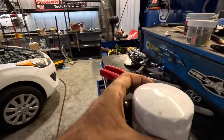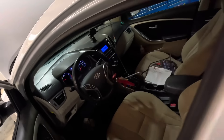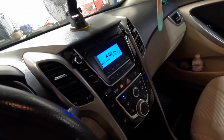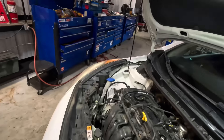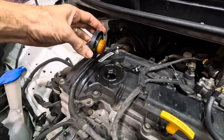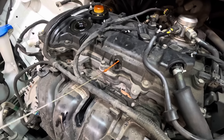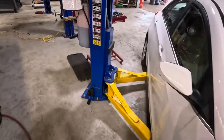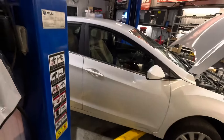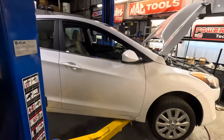It's been past the allotted time — let's check the clock. I feel some heat coming off this thing. It's 4:03 PM — we've exceeded the allotted amount of time, which is good. More cleaning is better than less cleaning, right? So we're shut down. No smoke rolled out. Engine oil level — the oil looks about the same, not super black, not clear — about the same as when we started. Let's run this thing back up, spill-and-fill it, then run it again and see if we have any blow-by or at least reduced blow-by.